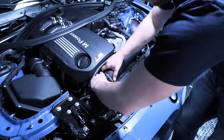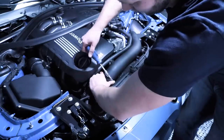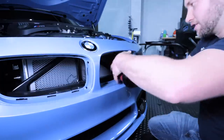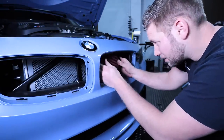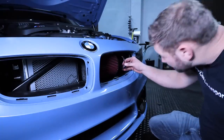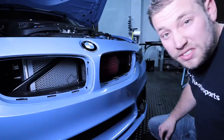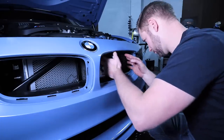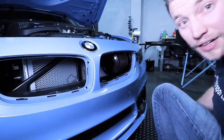Pull up on the inlet a little bit and make sure the intake is pretty far in there. Tighten down the six millimeter, squish this down a little bit, and make sure that you have a nice edge. Put your hose clamp on, slide it on and tighten it up. One side done — let's do the other side.